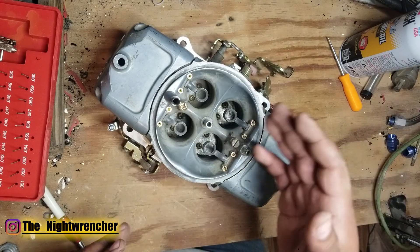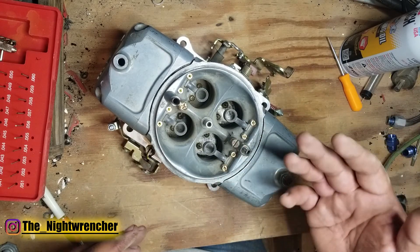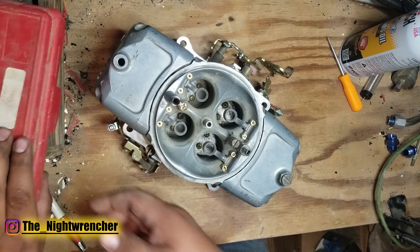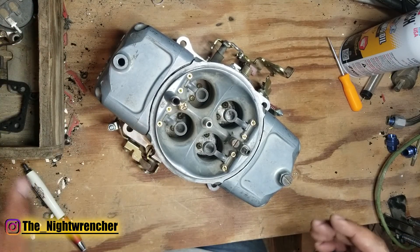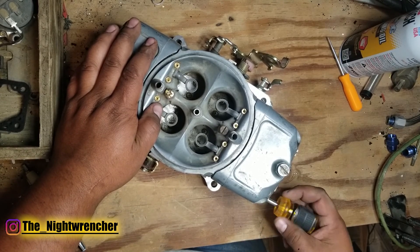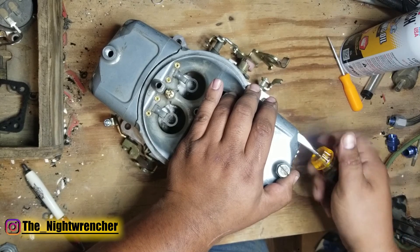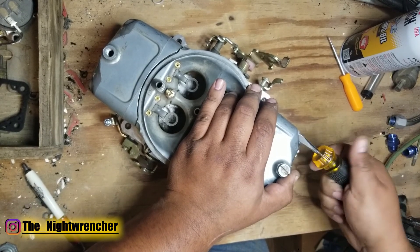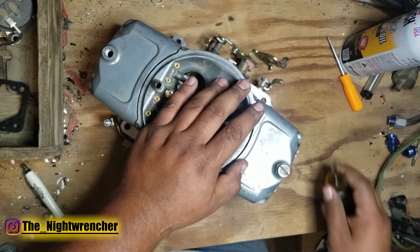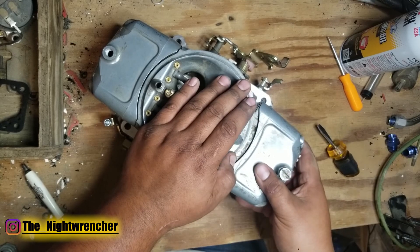From there I'm going to be making the proper adjustments to be more or less where I want to be, and write those on the piece of paper as well. When I start doing modifications later on and we start reading the AFR gauge and figuring out exactly where the carburetor is running, we're going to make adjustments to that as well. We're going to go ahead and pull off one of the bolts first and get a reading off the primary side. Normally these carburetors take a 5/16 or an 8-millimeter socket, but the Demon uses Allen head bolts. I'm using a flathead that worked fine — I don't really feel like looking for the quarter-inch Allen key. I have extras of these in case I gall them, but they're actually pretty strong so I don't think we're going to have any issues.